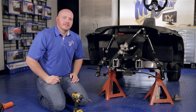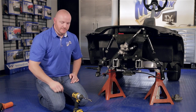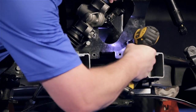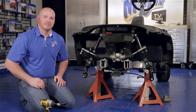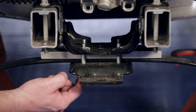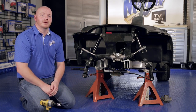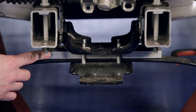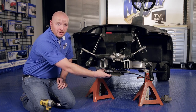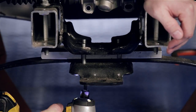Then we're going to use the same half inch socket and remove the two bolts that hold the factory A arms on. Make sure to retain your hardware. Next we're going to remove the front suspension by taking out the four bolts located under the bottom of the spring plate. We're going to retain the spring plate only. You'll notice on this cart we have a low pro lift block in place — we're going to use a 17 millimeter socket here, but if you have factory parts you need to use a 10 millimeter socket.